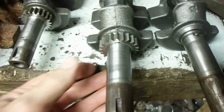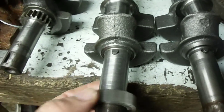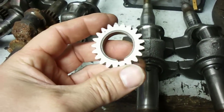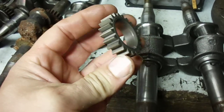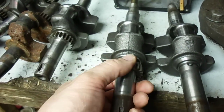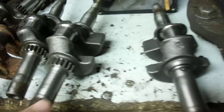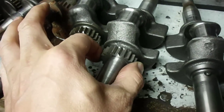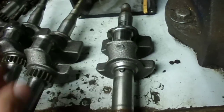With the magnetron ignition they also made the gear removable — there's just a square peg there. This is a sintered metal gear: they take powder metal, slam it into a mold, heat it up, and melt it all together. It slides onto the crankshaft. I've actually broken a couple of these — on my Briggs 327 stacker, one broke from vibration. Next time I'll JB Weld it to the crankshaft.